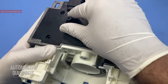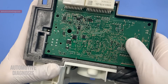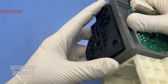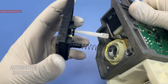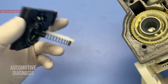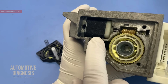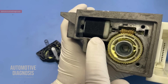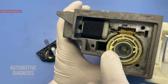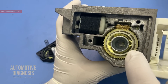I've already removed the screws to make it faster for this video. If I remove this cover you can see the control unit itself, and if I remove this other cover I can see the steering column mechanism. This spring sits at the center of the steering lock mechanism. We have a DC motor here to activate the steering lock, and this gear is really important for the steering lock mechanism.